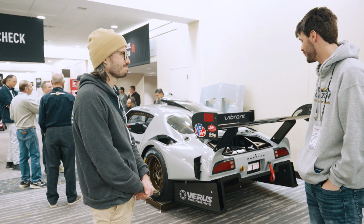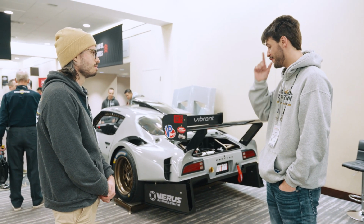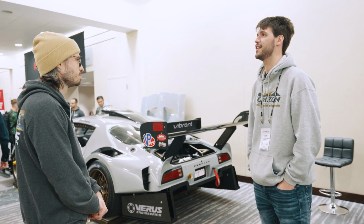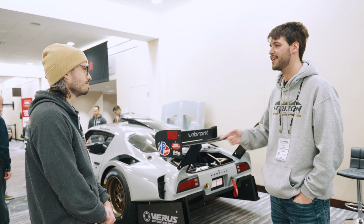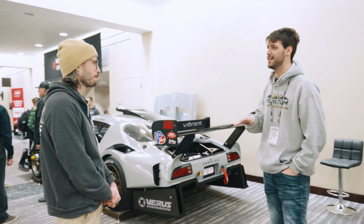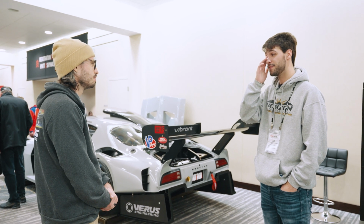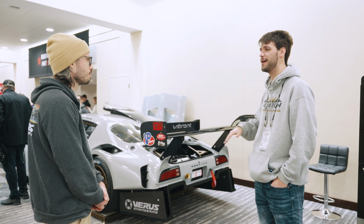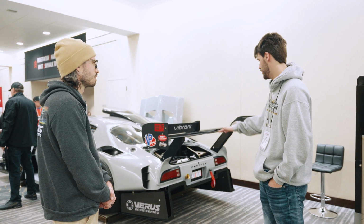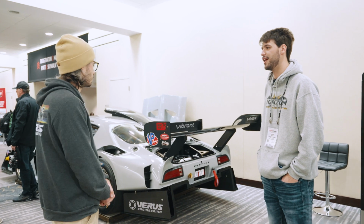Turned out great. Yeah, I'm really happy with the way it turned out. And I didn't want to go forward on the design without knowing it worked. That was my main thing, because it took us like 2 or 3 weeks of effort. I could send you guys photos of what it looked like, but we did it all wet lay, which was probably not the way to do it. Probably infusion would have been the way to do it, because then you could have actually got it placed in time. Even though we had slow hardener, we had to build the top section out, and then we built the sides. Okay. So that's what we had to do.